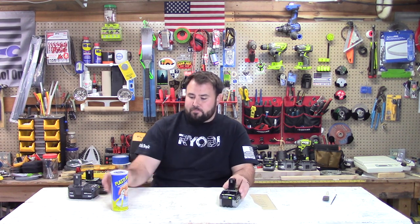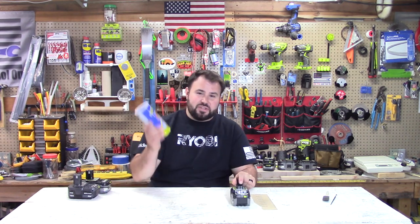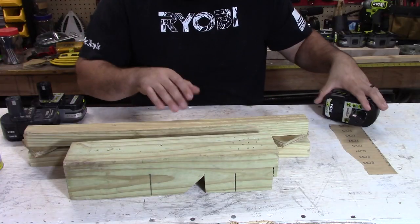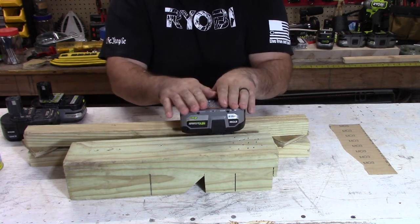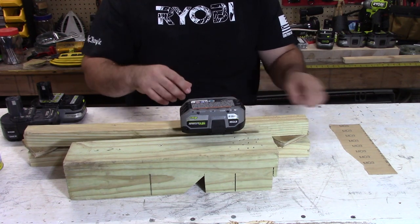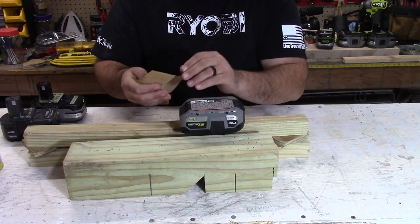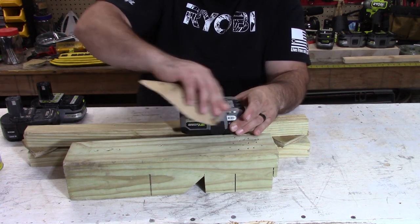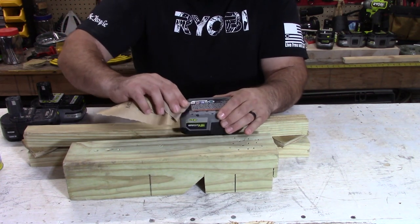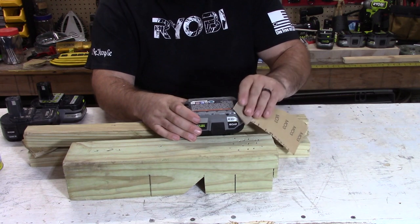Let's go ahead and jump into this. We're going to make this a pretty quick video. I've set up two pieces of wood because you're going to need the battery to stay upside down — this provides a really good area to work on. We need to prep the battery first, so I'm going to scuff the surface up just to give a little better adhesion for the Plasti Dip. Just scratch the surface — you don't have to sand it down completely, just scuff it up to give it something more than a smooth surface to adhere to.